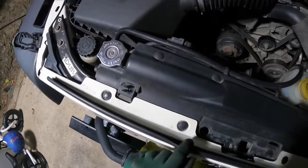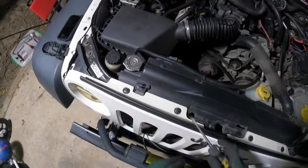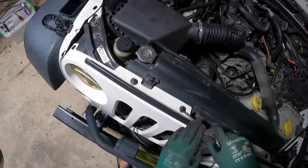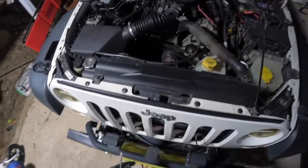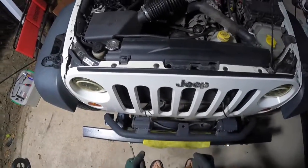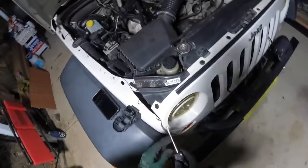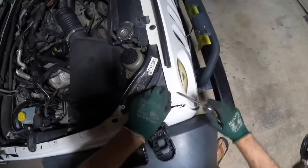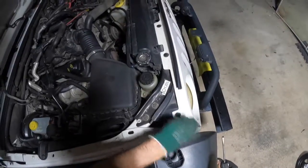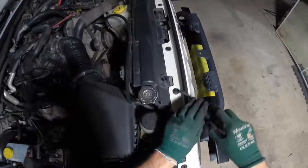As you can see, there's little pry marks, little indents there. We actually prop the screwdriver or the remover tool in and pop those up. Those pop up, and there's a few clips down the bottom we just pull forward. So we're going to remove these six little clips now and put them in a safe place for when we reinstall our grill. So very simple, they just pry off. Very easy and simple.